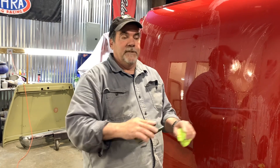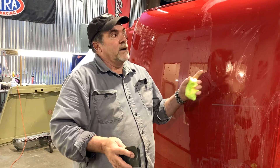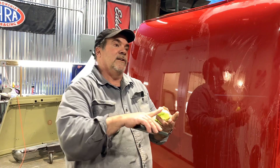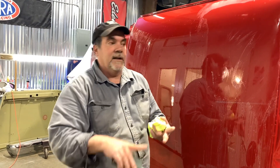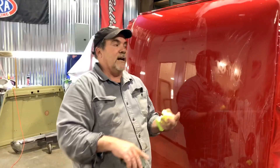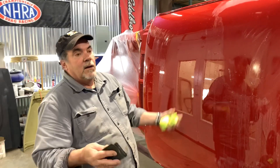With their Trizac, we use one product on this car when I'm done sanding — one product only and you're done. When I first started doing this, you had to wet sand, use rubbing compound, a mid-cut, a fine cut, then swirl mark remover, then wax — it was a huge ordeal to buff a car to a shine. They've made it much easier now, though it's not cheap.